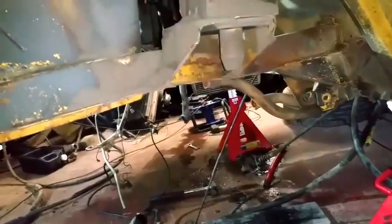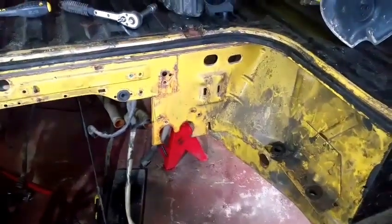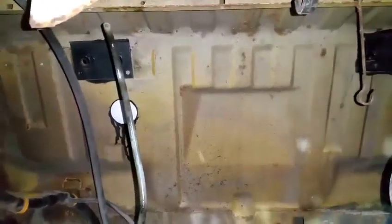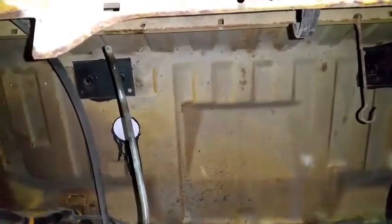Now everything's ready, more or less. I've just pulled everything out. I want to get underneath there — I might do it today. I'll put the engine bay lid back on, get underneath there with the sandblaster and give it a good blast out, not to take it back to metal but really just to take off the loose stuff, any rust, and to key up the existing paint ready for a freshen up. I'll probably just do it black to be honest — it's all got to be shot blasted and painted. I'll use Schutz underseal on there as well, then get it ready for the fuel tank that's got to be fitted up there. That would be the first part of the project — getting the fuel tank all in place.